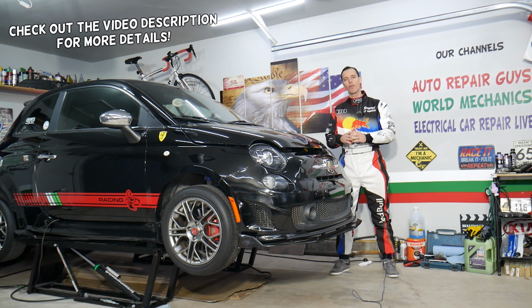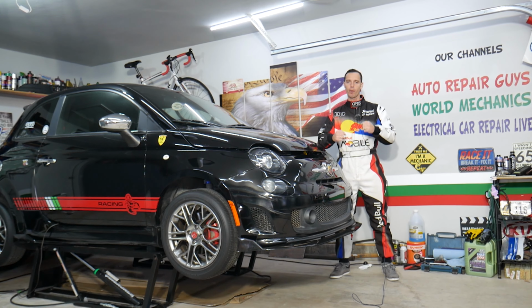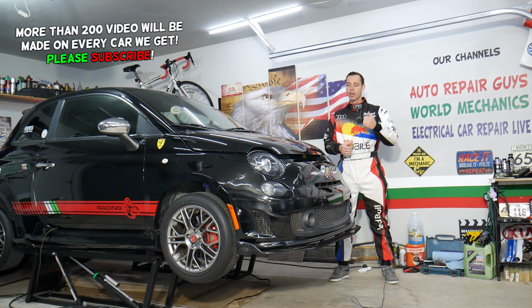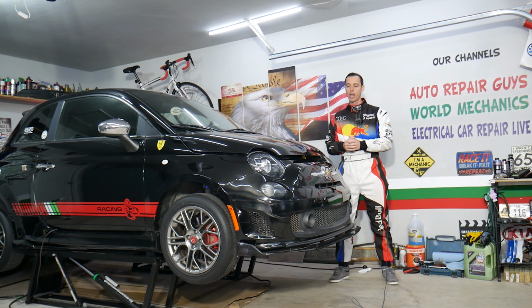Today will be a super helpful video for any of you guys having a Fiat 500. If you have one of those and you have problems with the power steering pump, you're trying to find where the fuse for the power steering pump is located, stay with us, we'll explain that today. If your power steering pump does not work, it's actually an electric one, check that fuse first.